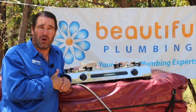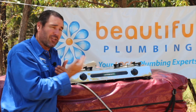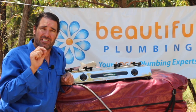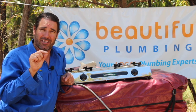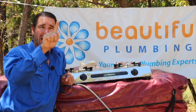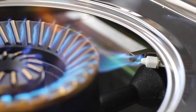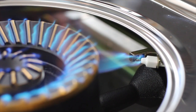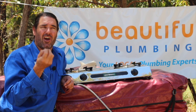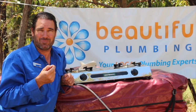This is the owner's double wok burner made by Companion. It's a little big, but it has some great features. One of them is that the ignition system has a flame thrower on it. When you push the button in, right before it sparks, it shoots gas over a little electrode that lights it, and that means it throws a flame up onto the burner. So even in windy conditions it'll light very easily. You only really see these flame-throwing ignition systems on the more upmarket barbecues.